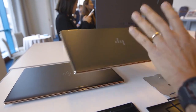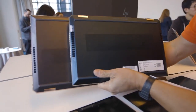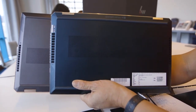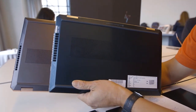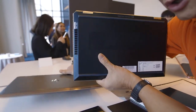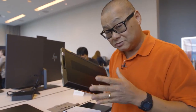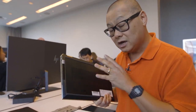Wi-Fi, which used to be on top, is now on the bottom, and it's Wi-Fi 6. Looking at the bottom vents, the holes and vents are a bit bigger than the previous model, so it should outperform it — though HP isn't giving exact performance numbers yet. Mostly upgradable: the M.2 SSD is not soldered on either model. Interestingly, the 9750H version comes with BGA memory, while the Comet Lake U version comes with SODIMMs. The reason is space — SODIMMs take more room and Z-height, and they couldn't fit them alongside the hotter 9750H. I'm curious to see how a 9750H 6-core compares to a Comet Lake U 6-core in this larger chassis, which should allow it to perform better than in a smaller laptop.